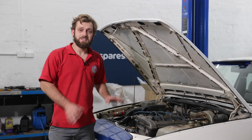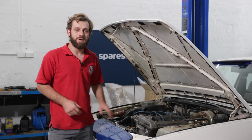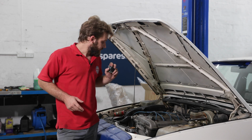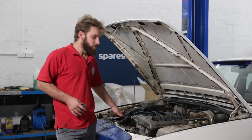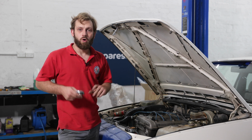In the case of some cars like this one, it will have a bleed screw located somewhere on the motor. It's imperative that you use these to bleed the cooling system, as this will be the high point of your cooling system and the only way air will escape completely. Once you have no more air coming out of your cooling system and your top and bottom radiator hoses are hot, or you've seen the thermal fans cycle on and off indicating that your thermostat has opened, it's time to put the radiator cap on and call it a job done.